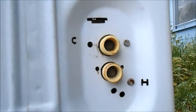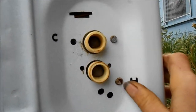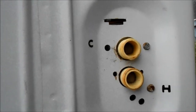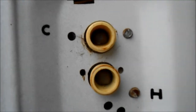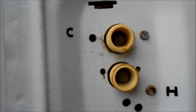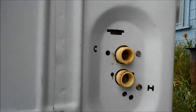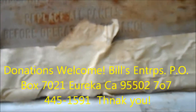On your water feeds, normally they are marked somewhere on the machine — they may not be marked as clearly as these, but normally they are marked. You want to make sure that there is no debris clogged up in your screens. You need to leave the screens in place; you can take them out to clean them, but make sure they go back in correctly. Because if there is a bit of debris that goes inside the valve, it can make the valve stick open.